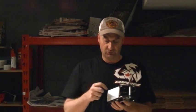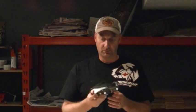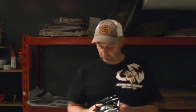We went to a four-hole bracket that clamps the link guard to the link. We're using nylock nuts. We're not doing any threaded aluminum. And the other thing we're doing, and probably the biggest change, is we've gone to a UHMW plastic skid plate on the bottom, which is going to help basically slide over stuff easier and make the guard perform a little bit better for everybody when they're crossing over logs and rocks. So we're going to go over a little bit real quick here and show you how it's installed.